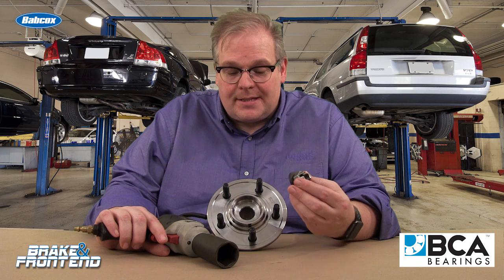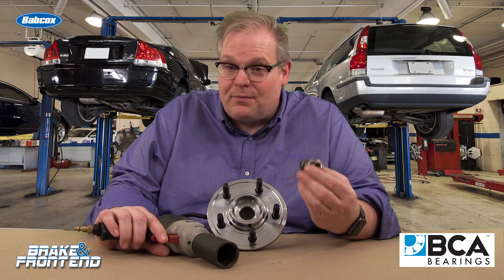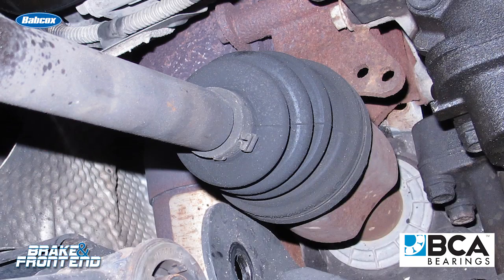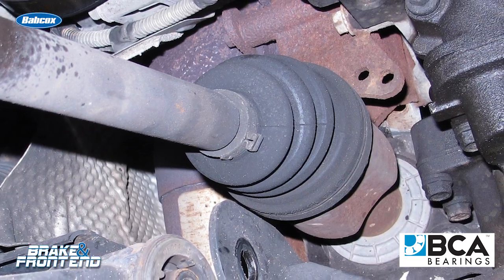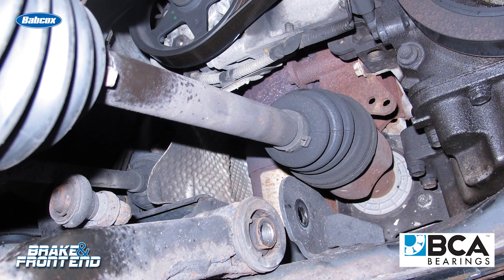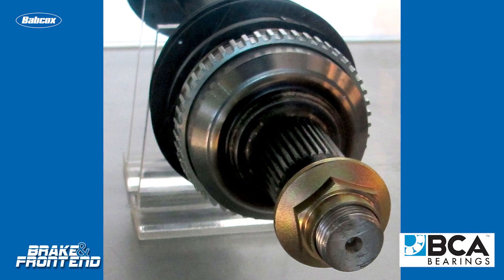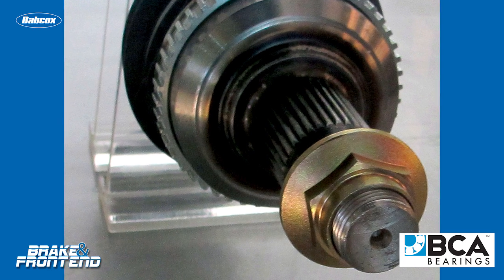The reason for this is the wheel bearing — yes, you can damage that — but more than likely, since the suspension is at full droop on the lift, the CV axles and the tripod joint, typically at the transaxle, could be damaged by the impact. These tiny needle bearings and also the surfaces inside of the joints can become damaged if you tighten up this nut with an impact.